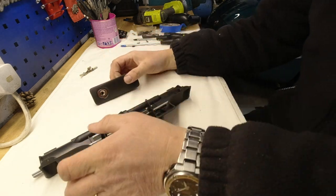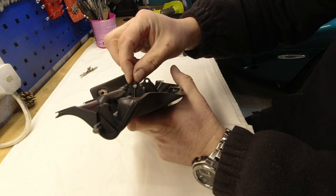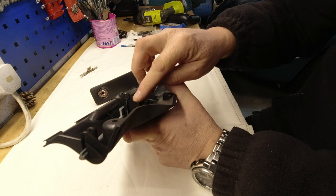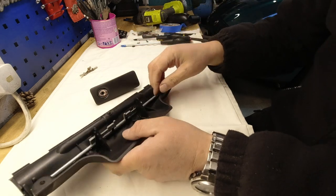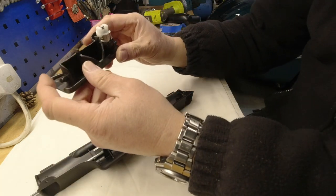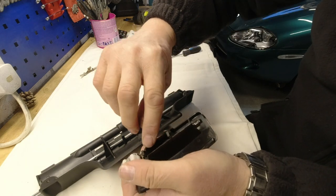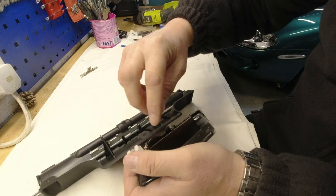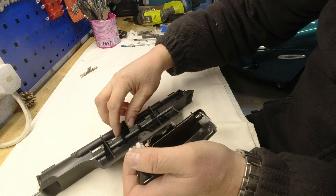Looking at the latch, nothing on mine is broken. These can break here — if it does you can reconstruct it with some plastic welding or adding a wire feature just to retain that clip. But in mine everything's in good condition, it's just jumped out of where it should be, which was probably because it was getting a bit stiff. On the back here we have these two tracks that squeeze these two pins together — they're a little bit worn, and I shall put a little bit of light lithium grease on there before I reassemble.